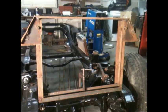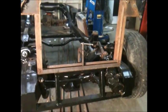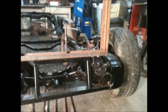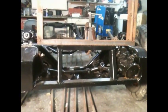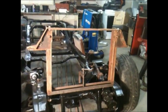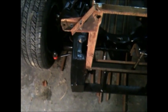Here it is sitting on the chassis, just clamped down. You can see there's not much clearance between the steering box and the brackets, so that should work okay. To get this centered on the chassis or the frame, make sure that you measure from the outside of the frame to the sides of the bracket, because the inside contours of the chassis are different because of the steering box being over here.